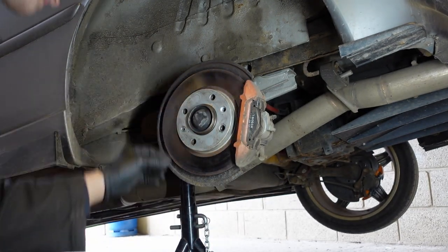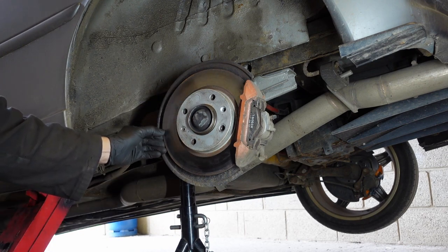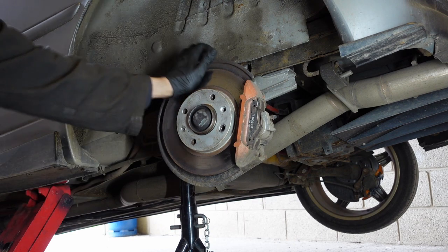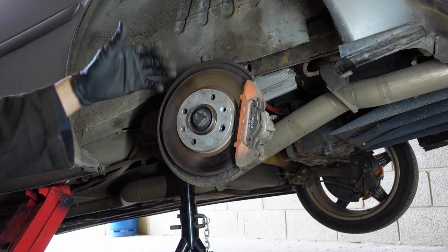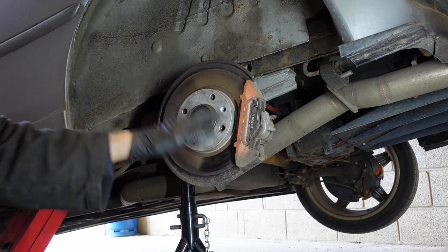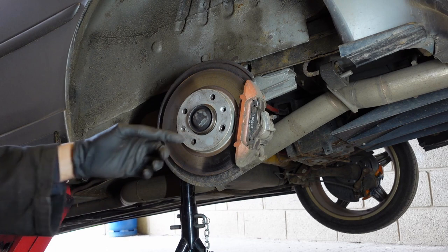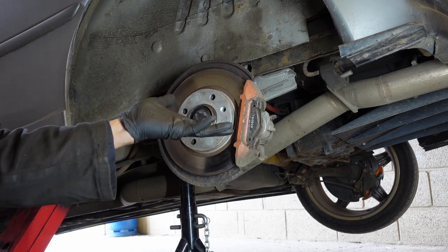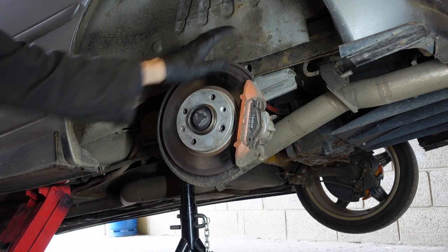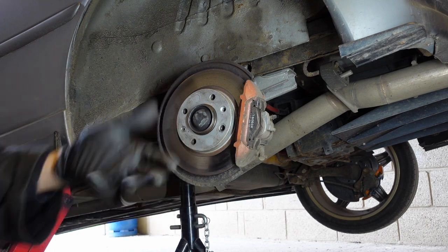I have been overheating these — they are a nice tinge of black right now, and they're not very old at all. There's zero lip; they've done maybe 500 miles. But all that 500 miles is hard work for these rear brakes, because I'm doing a lot of on-the-road tuning, accelerating hard, braking hard, and these turn all sorts of colours of the rainbow while the fronts are barely warm. We're also planning for the NC500 — this is the Lemon.